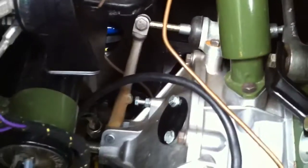This is an area that we've had a lot of interest on Cooper Road Mini, of how to set these up to where they're consistent. This works great. There's great feel to the clutch, but we can see down here there's a gap, and there's no return spring. So essentially this ends up relaxing in a spot where the arm is pretty much out, picking the throw-out bearing up and slightly preloading it onto the spinning assembly. We'd rather not have that.